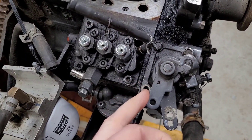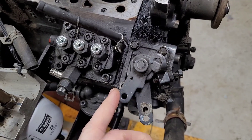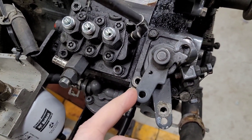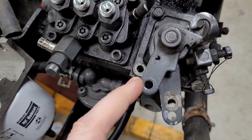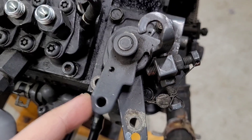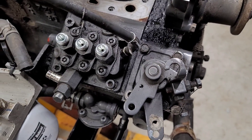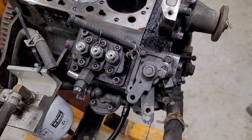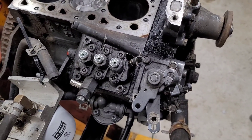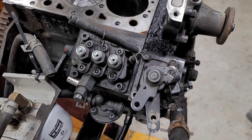The other thing I noticed — this is supposed to kill it, but it didn't. I noticed now that it doesn't have the full range of motion. You can see the set screw — it should be going against that, but it's not moving all the way up to that screw. So I think the range of motion is limited by something. Hopefully we can open it up and loosen that up without taking everything apart or finding a more serious problem with the fuel pump.